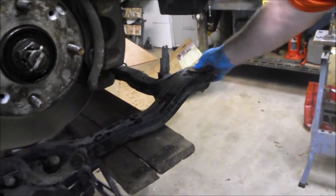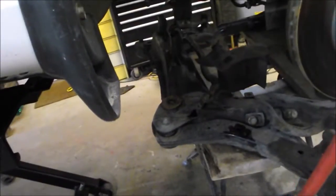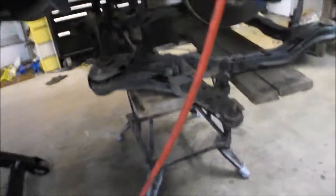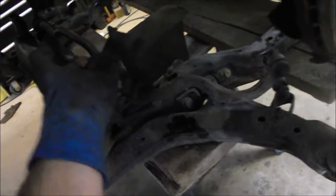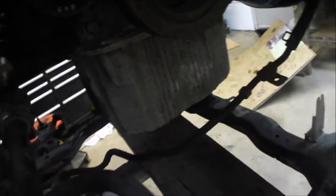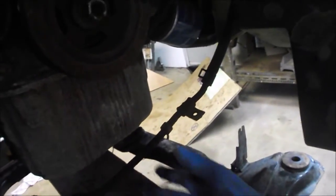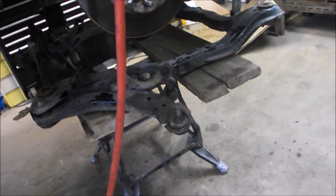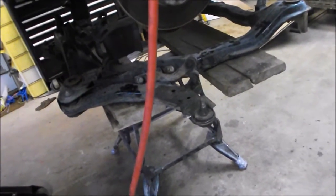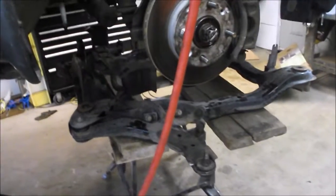We'll line up the ball joints with the lower control arm. The bushings that go on top of the subframe — there are four of them. The larger ones go in the back and the smaller ones go in the front. When raising the subframe we'll watch out for the little covers that need to bend out of the way to clear the steering rack, and we'll be careful of the hard line that goes to the power steering return line. The key thing is to take our time and communicate.